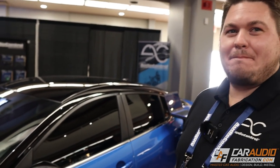So what that really tells us is that we're going to want to tune our system at that volume or very close to it. And if we're setting this up for a customer, we're going to want to let the customer know that — in this case, let's say volume 35 is your max volume. A lot of people will ask, what if my customer still wants to go past that number? The truth is, if the system is set up correctly and you're using some quality gear, volume 35 should sound so good and be plenty loud to where they have no need to go past that number. Honestly, they probably won't even need to go that loud — but it just takes a little education.